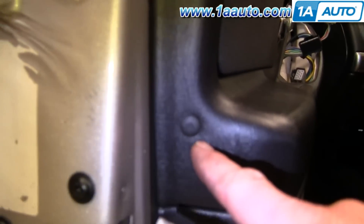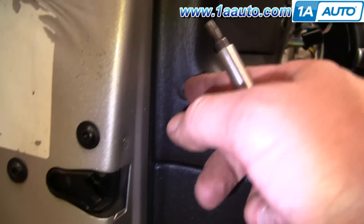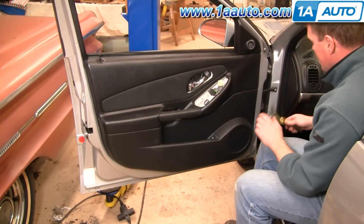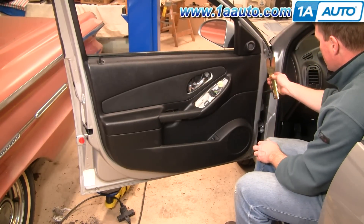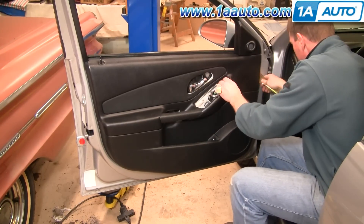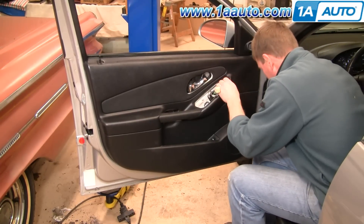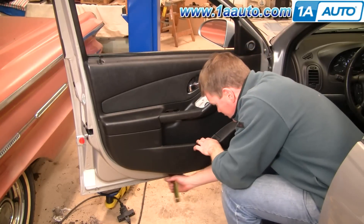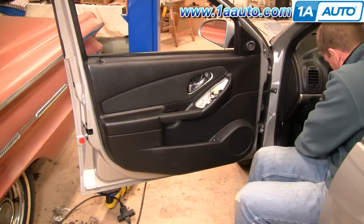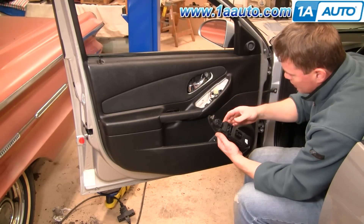On the back of the door there's a little fastener — there's actually two of them. I'm missing one on this car, but you just push the center right in through and then pry them out. Now around the perimeter there's a series of pins. A door panel clip tool is the right tool; you can also use a household putty knife. Put it in and pry out on the panel. Work your way around and pop the pins free. There's a little clip that goes on your power window switch — push it back in like that.